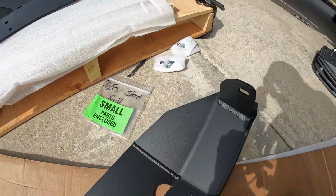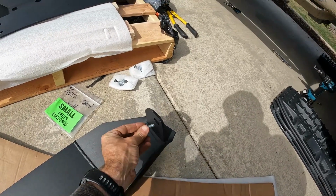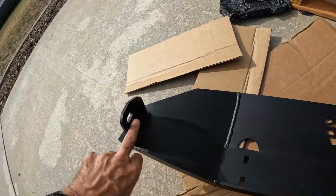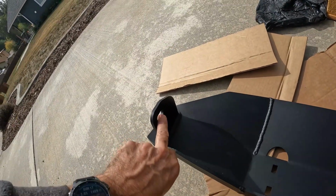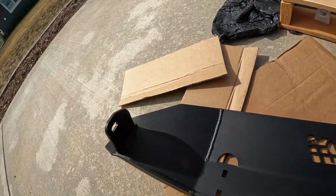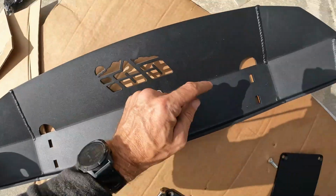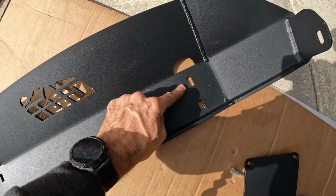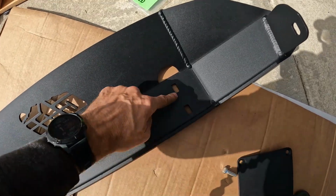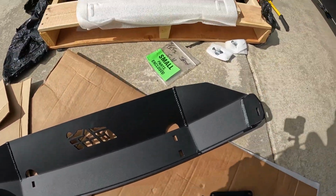This is the side that's gonna go to where that brake line is, where I cut it, and one bolt in. It has a nut already on the other side. On this side, this is going to go into a hole that's already there, one nut and a washer on the other side. That's what I couldn't find over here. And then the other plate is going to use these holes for a carriage bolt to get it all secured. So we'll go get this loosely put up there, and then I'll show you how the rest goes together.